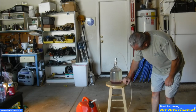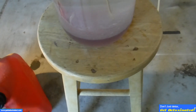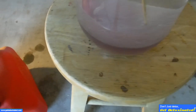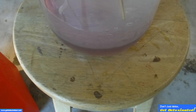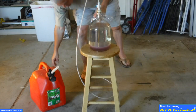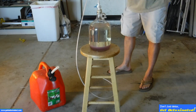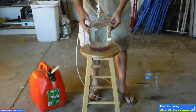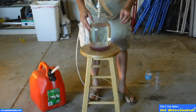There's what's called phase separation and it's very clearly visible at this point. You can see all the bubbling in that layer at the top — that's the top of the water-ethanol mix. That is the ethanol. The water and ethanol have settled at the bottom, and it's time to go ahead and drain this. I've got two bottles that are going to be used to collect it, because the gasoline sold in our state is E10, which means it's 10% ethanol. We should have at least a full bottle and then probably another half bottle when we're done.